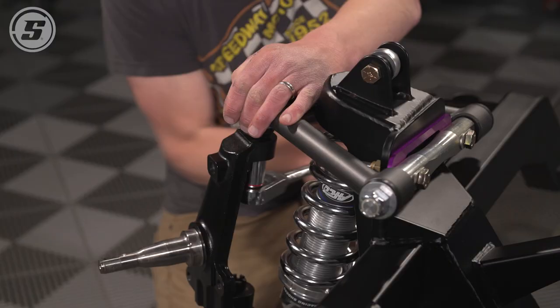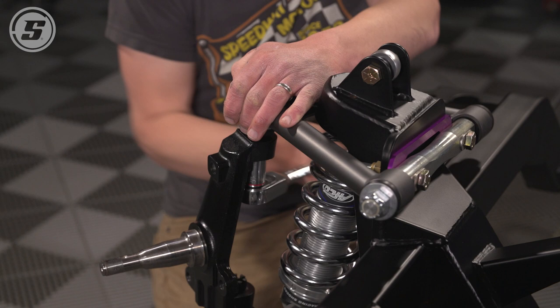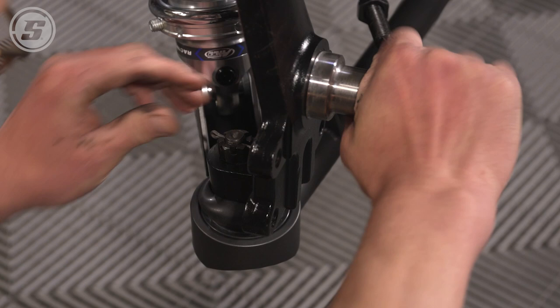And the idea here is that you actually have the tread surface of the tire, the part that's meant to grip the road, in contact with the road, not the sidewall all rolled over like it might've been on a stock Camaro or whatever. Especially with the earlier tire designs, they were taller tires, taller sidewalls. They would flex a lot more than a lot of the stuff does today. So keeping that tire contact patch flat was critical then.